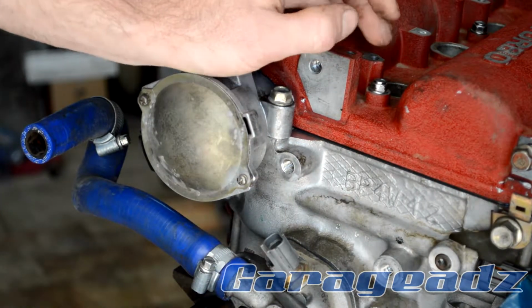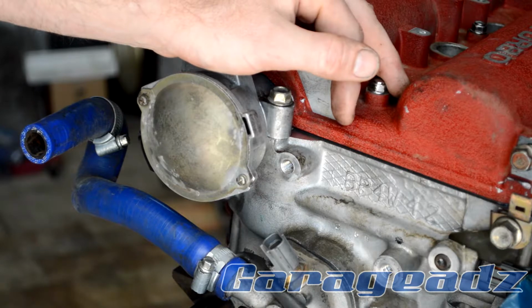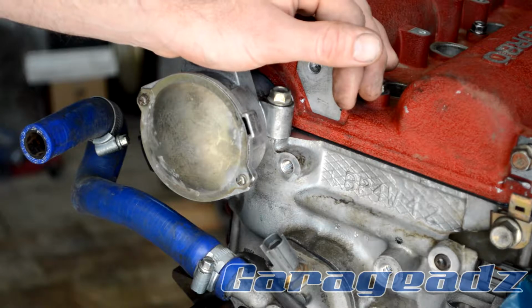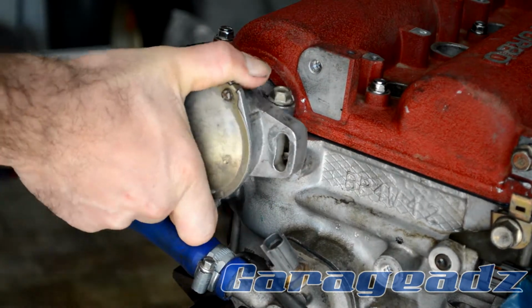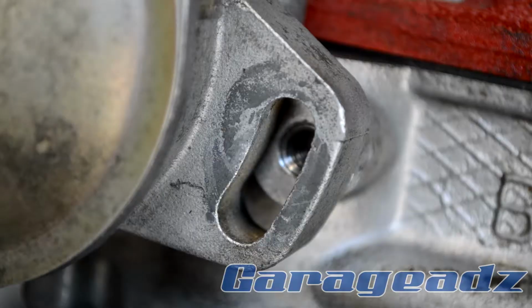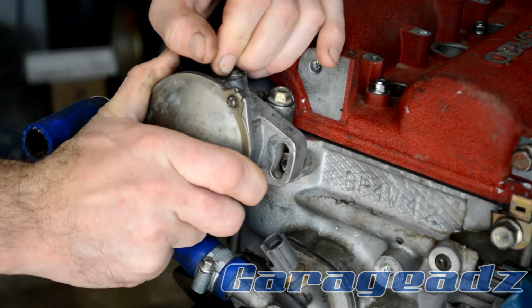So when we pulled it down, I went to take the bolt out of the crank angle sensor, and I said to my buddy, "Oh, did you already take the bolt out?" And he said, no, I think you took it out. So we both surmised that there was basically no bolt in the crank angle sensor. And what you will see from me turning this around, if you look really closely on here, there's a lot of marks from where the head of a bolt's been. Basically, this little guy was moving around without a bolt in it. It's gonna wibble wobble all over the place.